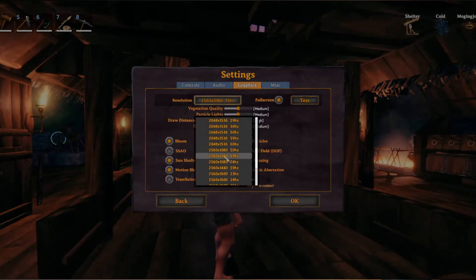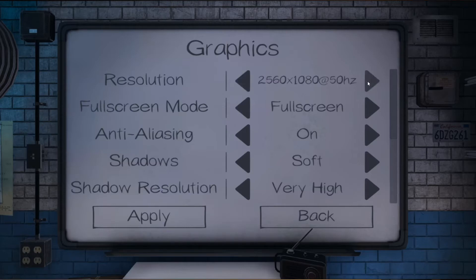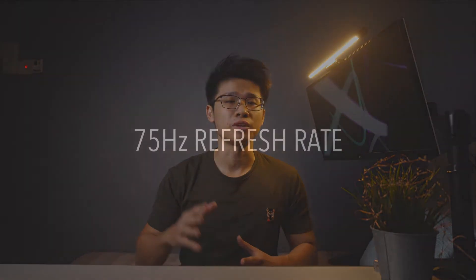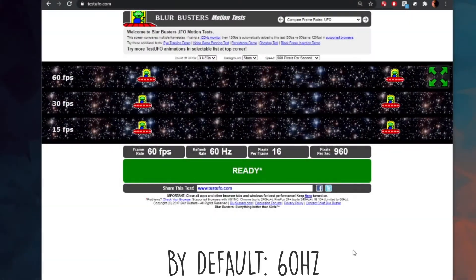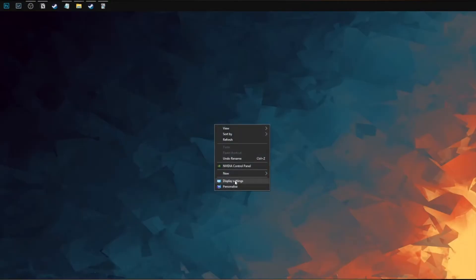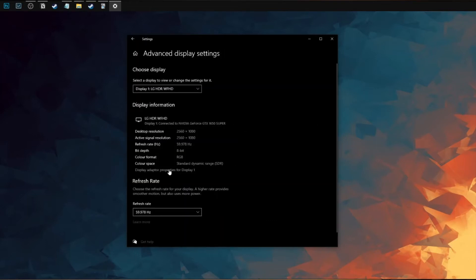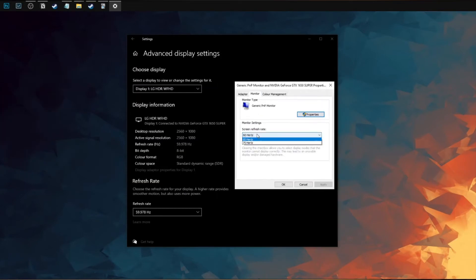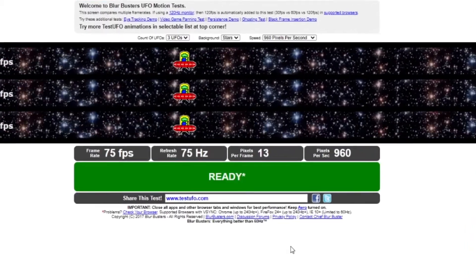And to my surprise, I am able to select the maximum resolution and fps in the settings. If you're into Phasmophobia, which was released recently as well, it also supports this resolution. A little thing to take note is that by default, the monitor doesn't apply the 75Hz refresh rate — you will have to do it manually. You can do it by heading to your display settings on your desktop, advanced display settings, display adapter properties for this monitor, go to monitor and select your refresh rate to 75Hz. I've then verified this using the refresh rate UFO test and it is good to go.